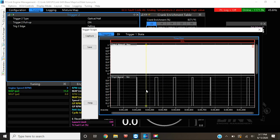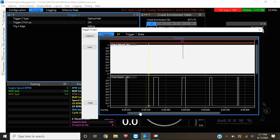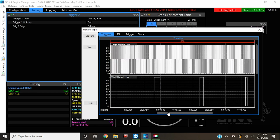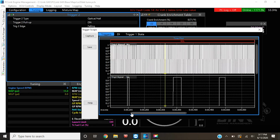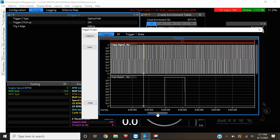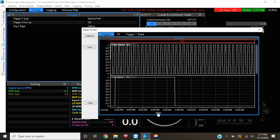The above looks pretty crazy and confusing, but as we widen the resolution, you can see that it's not just one solid chunk. It is actually a bunch of small pickups, since the Nissan is ridiculous and uses something like a 100-tooth pickup wheel. And as you spread it open, you can see that it actually is pickup points. So we can see that the sensor is picking up not only the crank sensor but also the cam sensor, and we should be good to go.